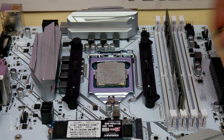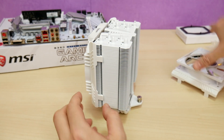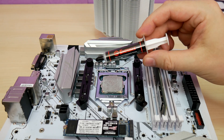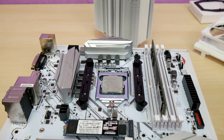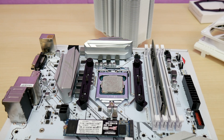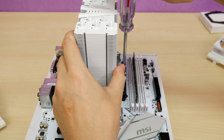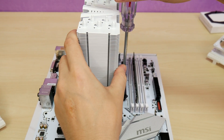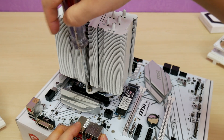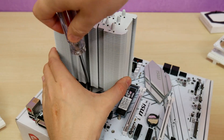The CPU already has some grease applied from my last build. Undoing the clips is easy as we remove the front fan and back shroud from the cooler. The front of the mounting plate is easy to get to as the cooler is positioned off center towards the back. Enermax supplied a hefty amount of cooling compound — you should use a couple of rice grain-sized dollops on top of the CPU. You can also use the spreader to help cover the top, though the cooler pressing down will spread the compound pretty evenly. The cooler's attaching bolts sit on the threads coming up from the middle of the plates. Everything's looking good so far — I'm just tightening it down halfway. Now for the back, and I run into a problem here, as a normal screwdriver isn't long enough to drive the bolt, and even being careful it slips.